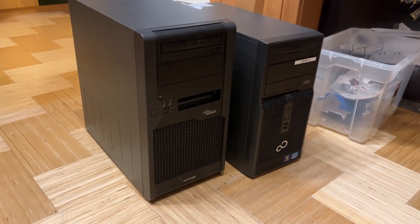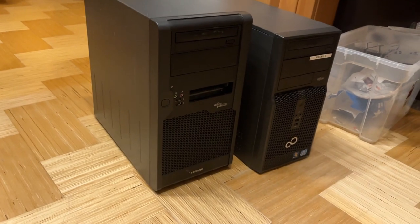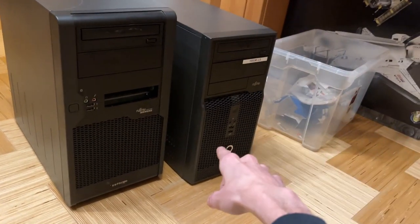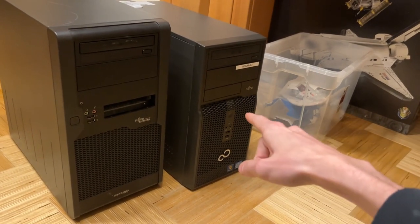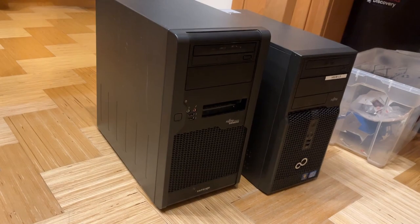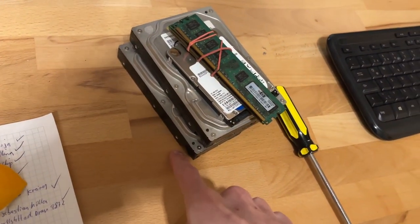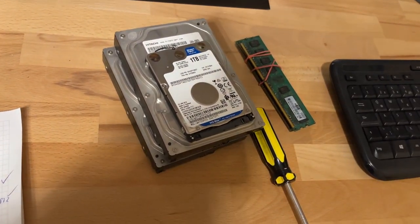Okay, it's quite some time later. I read all the Windows 7 keys from those machines. Turns out 2 hard drives are bad. They're just on their way out. So I threw them away. This power supply works perfectly. So this computer is back together and fully functional. So this is the one Be Quiet power supply that I bought. So this is completely done. And this has now a 500 gigabyte hard drive, which is also done. It has 4 gigabytes of RAM. And yeah, what remains to do is put in those hard disks in the 3 other remaining computers and upgrade some RAM. And that should be it, guys.